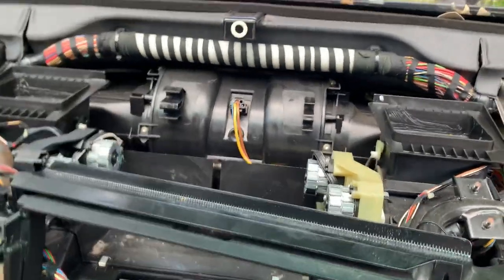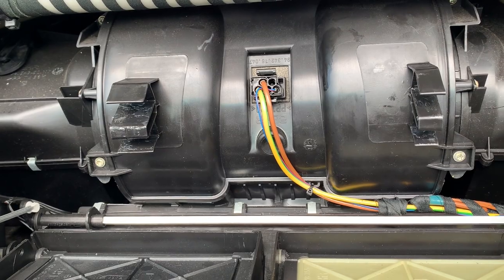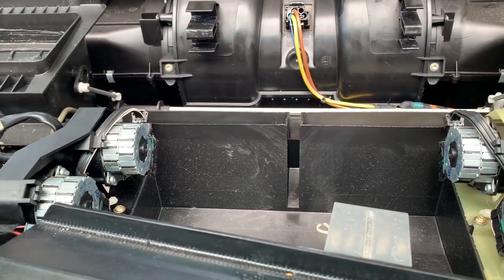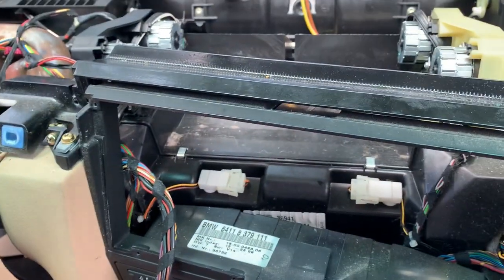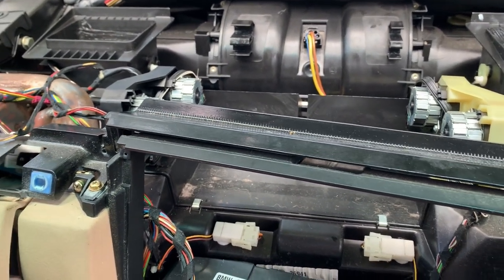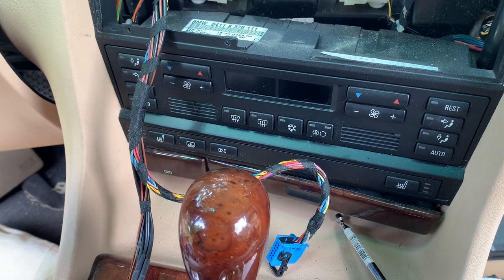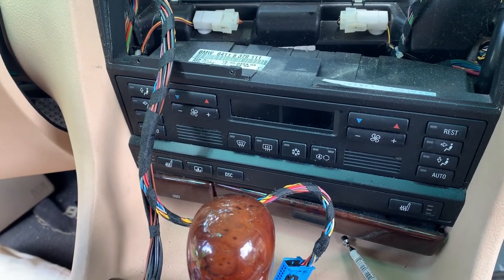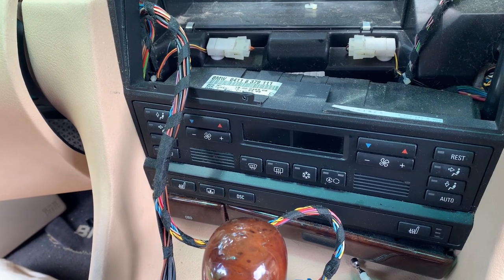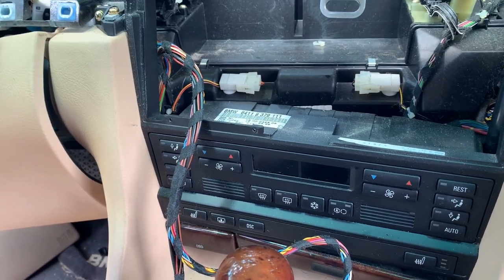Not sure if you're supposed to do this, but first let me show you I put the little cable tie on there to hold the electrical wires for the blower out of the way. The next thing I did was hook the battery back up — negative — put the key in, turned it on, which I'm not sure you're supposed to do with all this stuff disconnected. But the blower's last position was wide open, and when everything came on, it started blowing. Without testing, you can't be 100% sure if it's a bad blower motor or a bad blower resistor. Change them both, it works — so everything should be good going back.